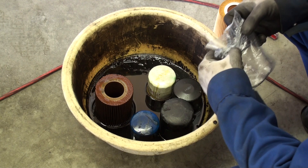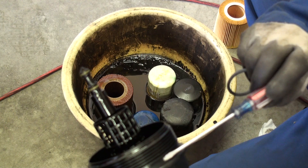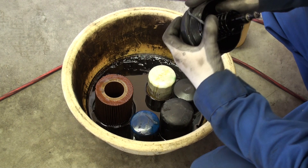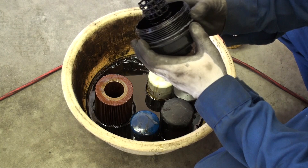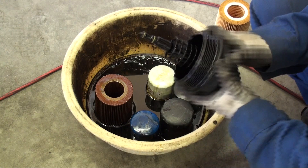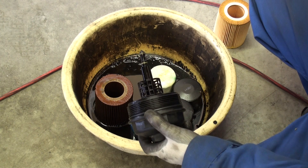This is what our new gasket looks like. Loop it on so that it sits in this little channel right here. Just loop this over carefully and then, using your fingers, carefully roll it back on and make sure that the lid is nice and clean with no debris in that groove that could cause a potential oil leak. Also pay attention to the two little O-rings on the end of the stem — that's really important because they must seal properly into the oil filter housing. If those are damaged, cracked, or missing, you need to order replacements from BMW.